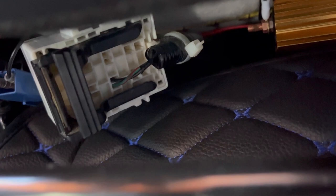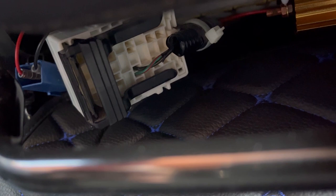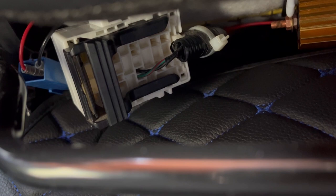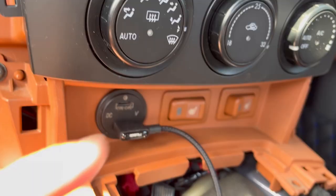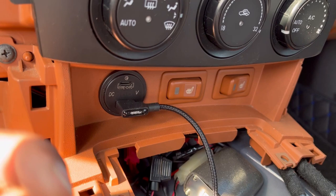If your car didn't come with seat heaters but you want to swap in seats that do have them, here's what to look for. Underneath the seat — looking at the passenger side — you'll see wires coming out from under the carpet going into that white connector block. The wires you're looking for are the green one with a red stripe and the black one with a white or yellow stripe. If you have those two wires coming from the vehicle side, your car already has the seat heater wiring. You'll just need to add switches to your center console — NC1 switches for an NC1, NC2/later switches for an NC2 — because the connector plugs behind the plastic panel are different and not interchangeable.